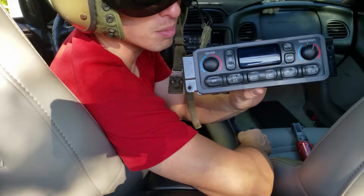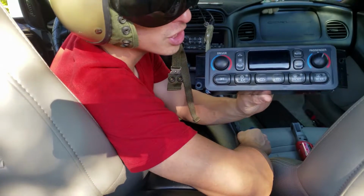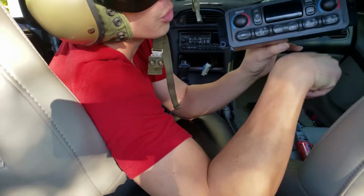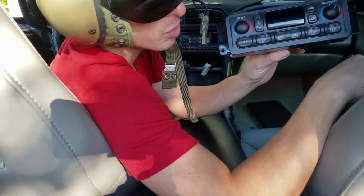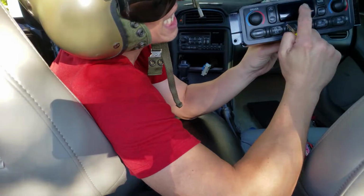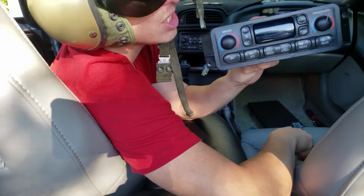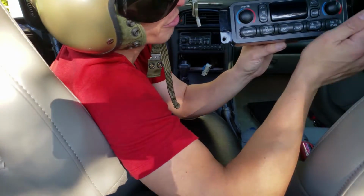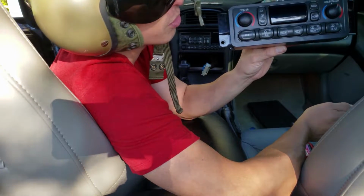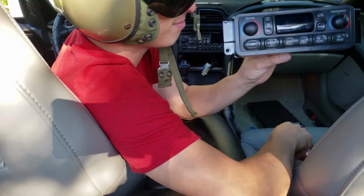Going to show you how to cure the problem with the C5 air conditioning control unit. A lot of the lights inside go out, so we're going to show you how to resolder some new lights in there, where to purchase them, and also the lights that show you the AC temperature and a few other functions. They go dim as well, and I'll show you those resistors that you'll have to put back into place for that.